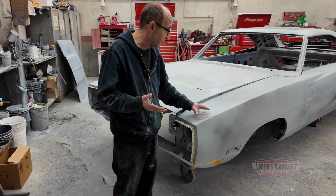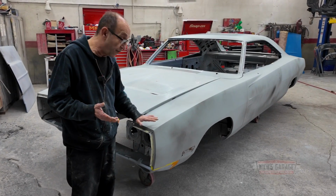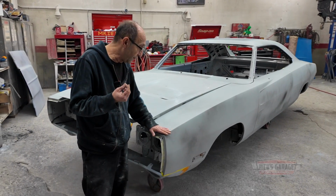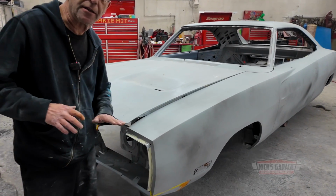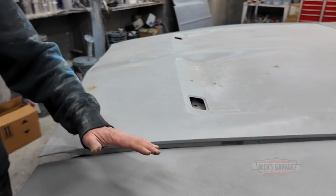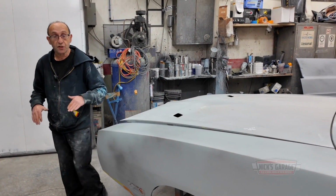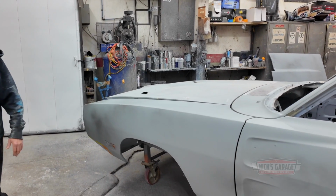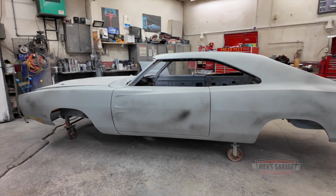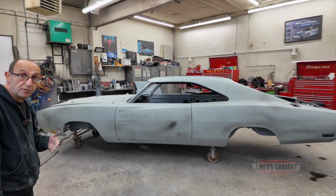Don't forget, these are all chemicals, so a lot of it vaporized. Okay, and it's still vaporizing. So if I would sand this today, it's sandable, although it would be wet. Even if I would sand it tomorrow and I get a nice perfect finish, okay, 10 days from now, that perfect finish that I had just sanded has already changed. It's settled again. So we're going to let all the settling happen. And then once that's all settled and hardened, then we can sand it. And what we will end up with is the actual shell of what we're going to prime onto.